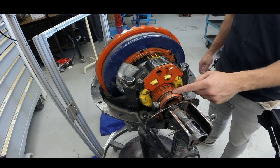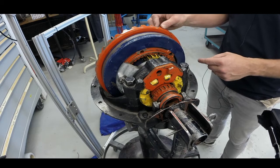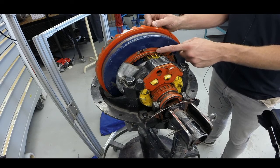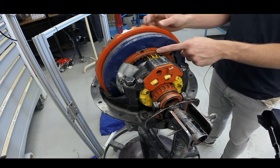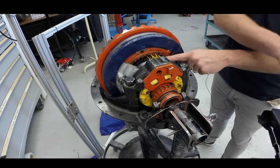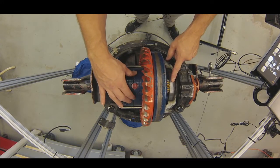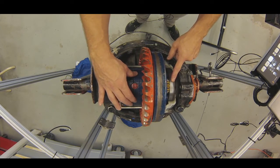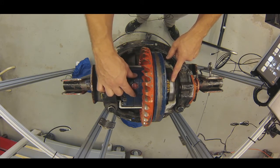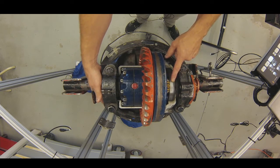This is the Sun for our planetary assembly. Our bevel gear is right here, remembering our bevel gear will be driven by our pinion, and our bevel gear being painted the same color as the internal in this case is mechanically one-to-one. We can see the edge of one of the planetary pinion gears and that's going to be held by the planetary carrier housing, and that carrier housing is actually the same housing as our differential case. Inside our differential case is going to be our spider shaft or cross shaft, our spider gears or differential pinions, and our axle side gear going out through the hole in the side — just like a typical rear axle.